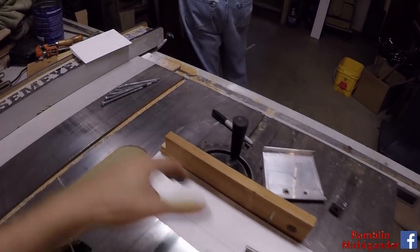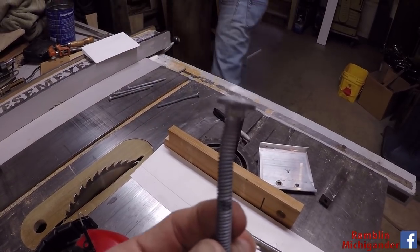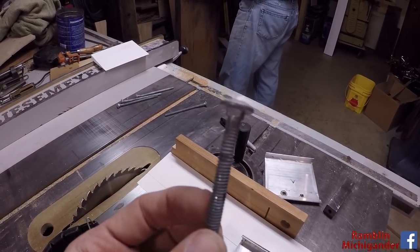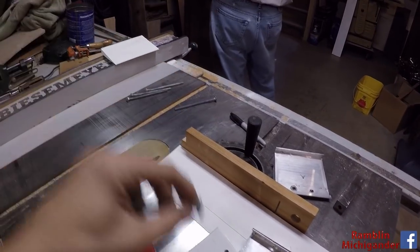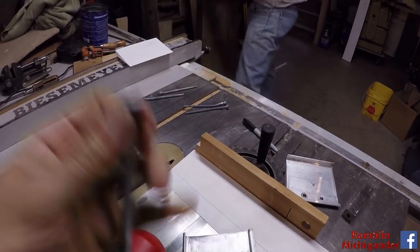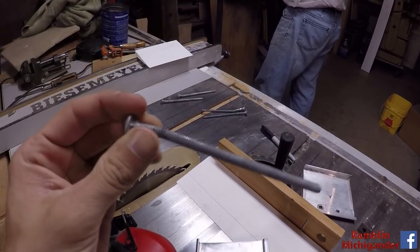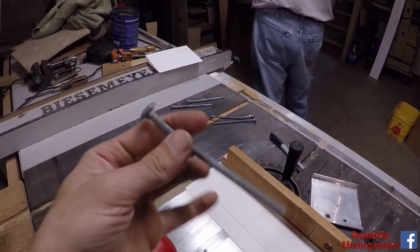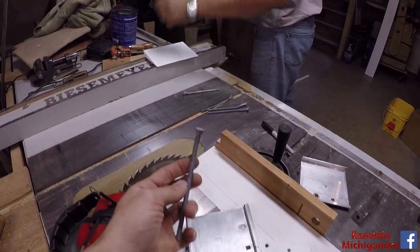So what Mike is doing is rebending these bolts. As you can see, we bent the head at an angle there, and he's got to rebend them to fit the second wedge so that when they go in, they are flat against the metal bracket, because they have to sit flush against this surface, but yet at the same time match the angle of the roof where the holes are already drilled. That way we can use one bolt, still be flat against this, and not have to drill new holes. So once we reassemble all of these, we'll get back to you.